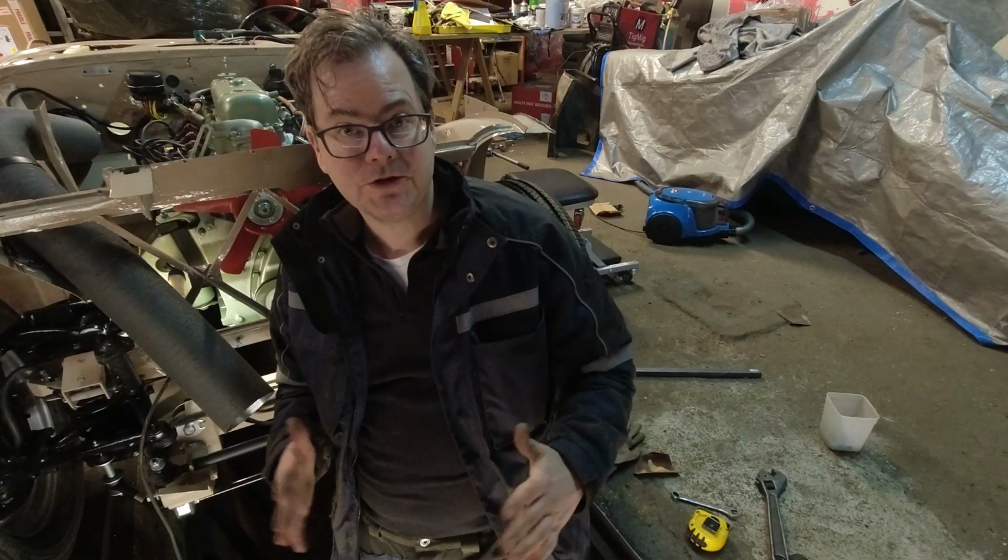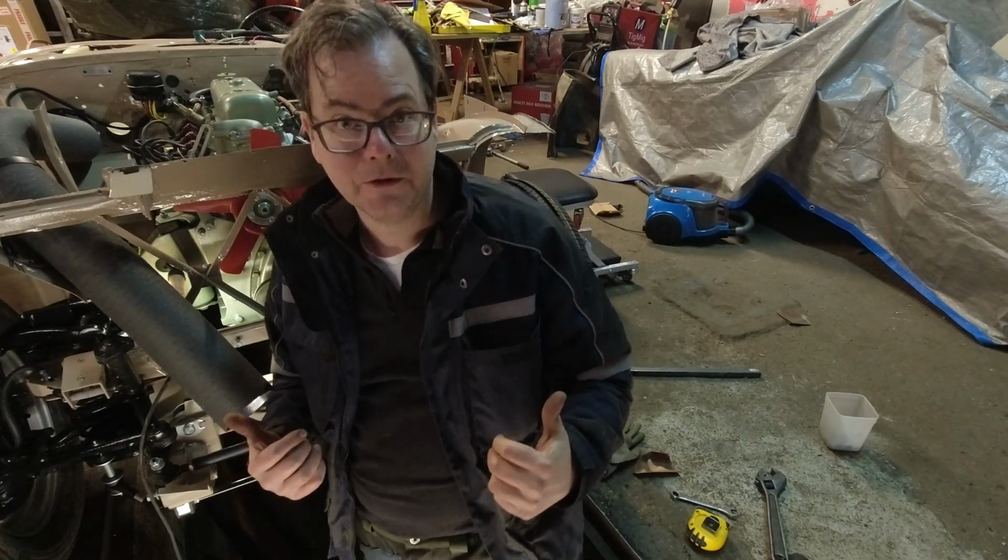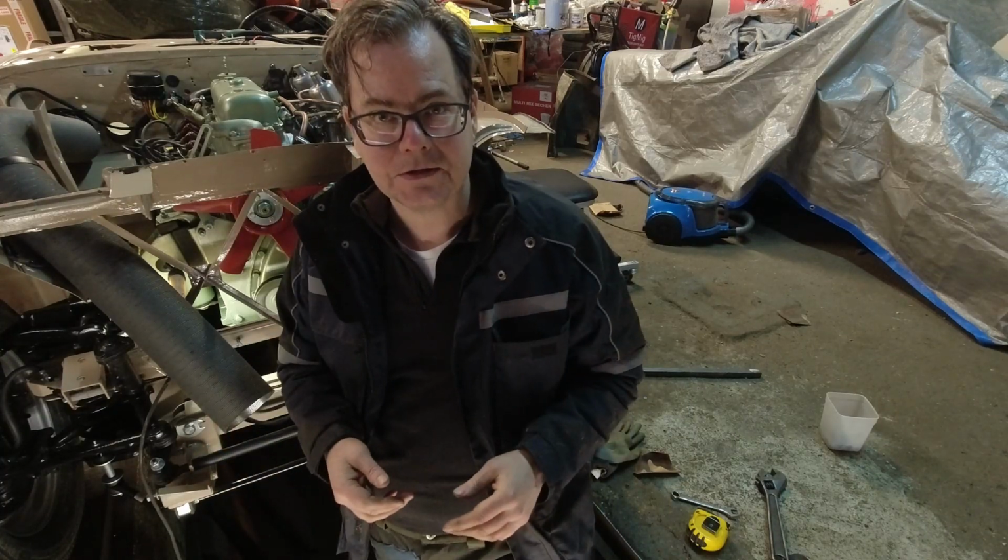Because it's had so much movement, I'm now going to go back. Before, the camber angle was in, and now it's out. It's supposed to be out, but that's where it is. So I'm wondering if that has affected the toe in, because why not? We're going to go back again and double check to see if it moved. I just checked the toe in with the new caster angle, and it changed dramatically, so I've adjusted that again. Now I've gone back to the camber angle and it's off a bit. So I'm going to adjust that and go back and forth until we can narrow it down to the right position.